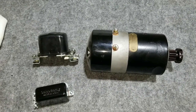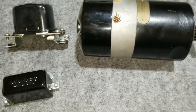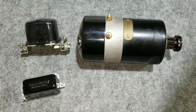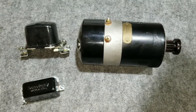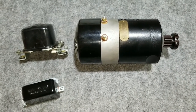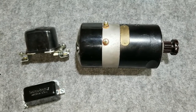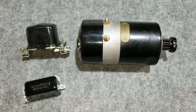All right, let's get started. This is pretty much a walkthrough for converting 1936 to 1957 motorcycles. I decided to make this modification on my 1940 — I mainly didn't want to run the lead-acid battery because of the possibility of acid spilling. I'd been reading a lot about lithium-ion batteries and how they're more dependable, smaller, not as heavy, and they last longer and charge well. A lithium-ion battery requires a regulator to charge it correctly — you can't use a relay because it doesn't provide the right continuous voltage and current like a regulator does.